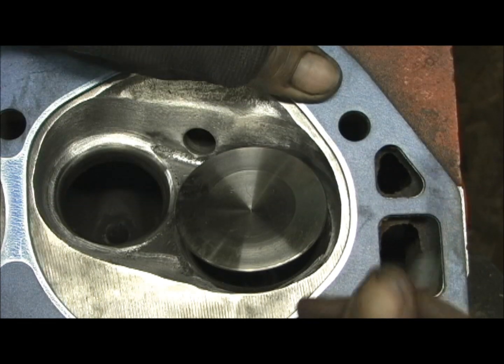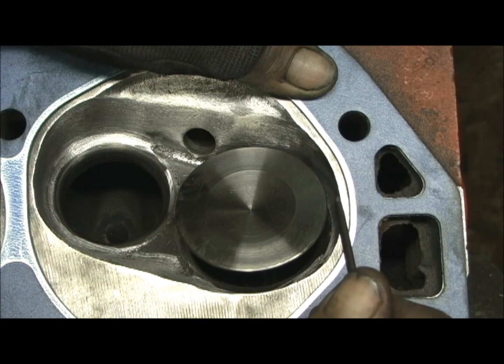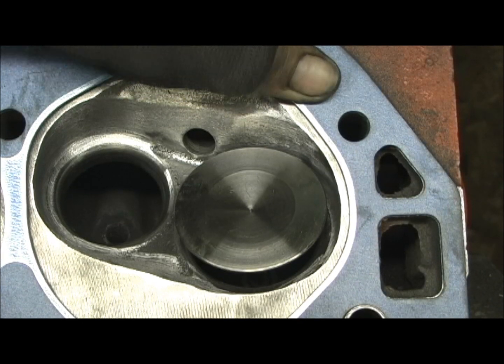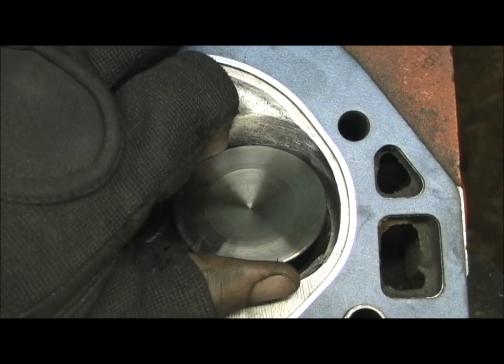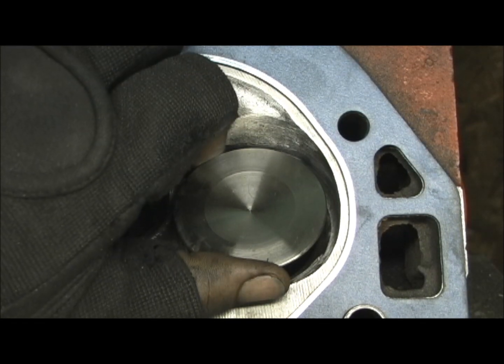It's just on the 396 Stage 4 — for people I've done this for, I've had several customers ask me why I don't unshroud it as much, or why I insist on staying with a 2.19 valve. Because unless you're willing to do some serious block notching on the 396 block — even more than what it has from the factory — you're going to hurt yourself more by putting the 2.250 valve in there than if you left it with the 2.19.